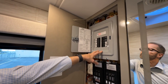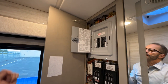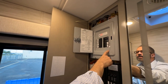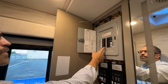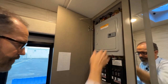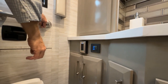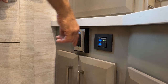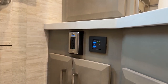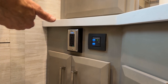The inverter must be on for the appliances on the sub panels to operate. Above the sub panels is the main breaker box for other appliances that don't require the inverter — they operate off shore power, the inverter, or the generator. These are labeled: engine block heater, rear air conditioner, cooktops, washer, dishwasher, and more. If tripped, reset them the same way — flip to the left then back to the right. Just below is the toilet flush and water level control. The top blue button adds water to the bowl; the lower one flushes. The green LED indicates it's ready to flush.